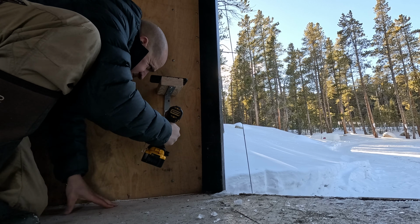So the thing that we need to do here as well is we gotta set this to compensate for the altitude. And apparently there's a way to do this. Settings. Okay. One, okay, six, okay, eight, okay, perfect. So this should be the minimum hertz rating. Let's get the altitude chart. Okay, P1, we're gonna drop to 1.1. We're gonna say okay. Two is gonna go to 3.5. Minimum fan speed, 1750. Max fan speed, 4500.